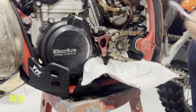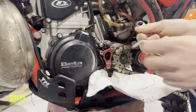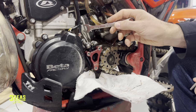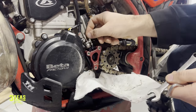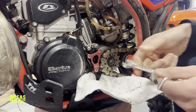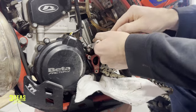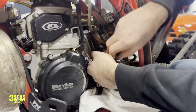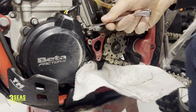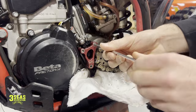The first thing I'm going to do is crack this banjo bolt loose now. If you wait to do it afterwards you're trying to hold it and crack it, and you want to kind of keep track of the orientation of how this cable is coming down so when you go to reinstall it you have a good idea of where it wants to be naturally. So I'm going to use the 13mm and crack this loose.